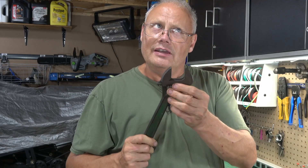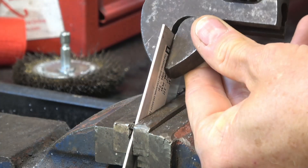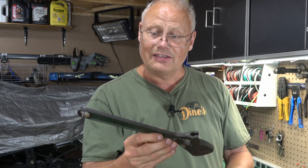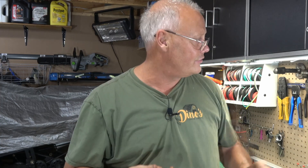Along with your combination wrenches, I'd also get a good medium-quality adjustable wrench. This will allow you to get the 24mm nut on the back of the DR650, or you can use the 24mm from your stock toolkit until you can afford to upgrade. A good adjustable wrench is handy not just for turning fasteners — you can tighten it down on bent aluminum like a bash plate and use it as a crowbar to straighten metal. A 12-inch (30cm) adjustable spanner can get you out of trouble.